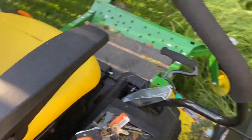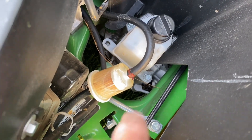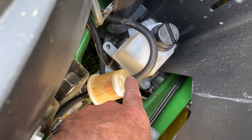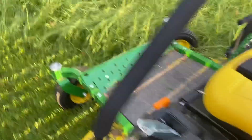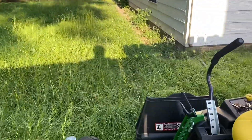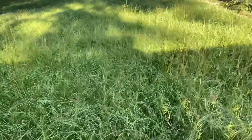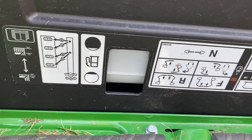The reason is this thing sucks fuel through the fuel pump, and when it gets low it fills up with air and then sucks everything from the bottom out. I've replaced the fuel filter — took me a while to get it primed and get some good gas back in it. After that it's run perfect, but I will not let it run out of gas again. It's got a huge tank — I think it's a five gallon tank. The tank is just really hard to see where the level is, so I'm gonna start paying more attention to that.